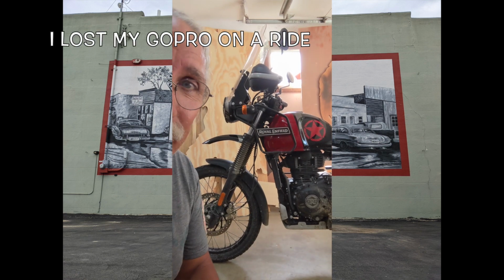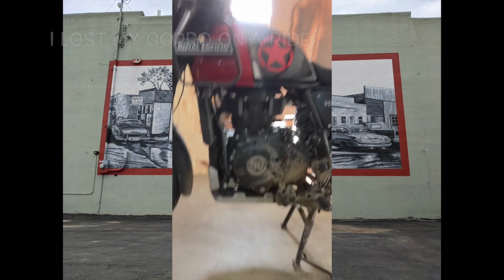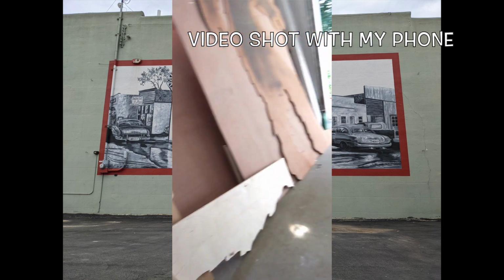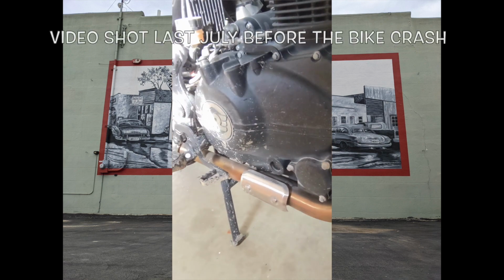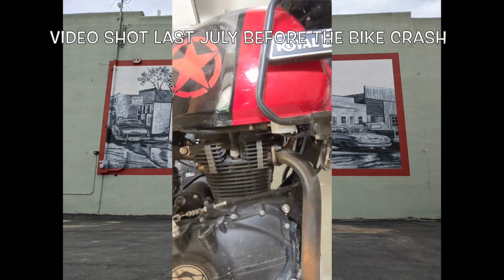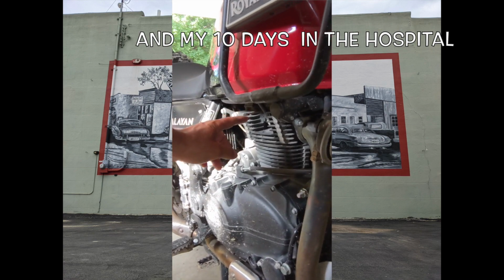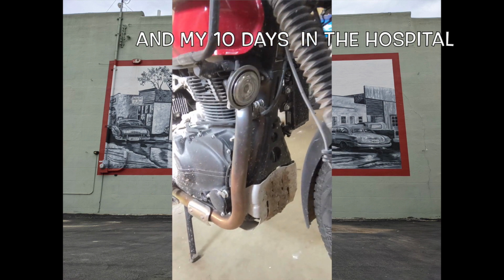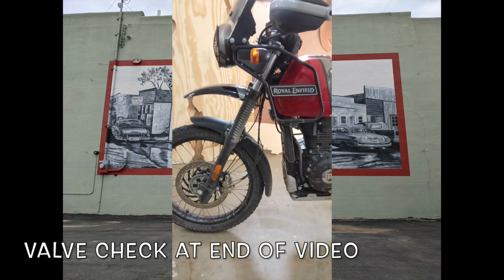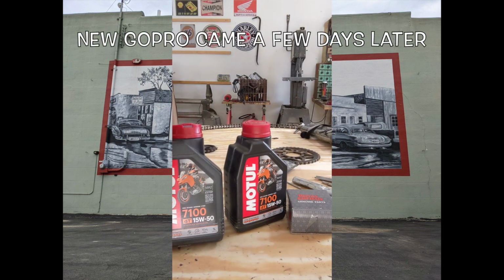That's the Hot Rod Himalayan right there. And tonight we are going to drain the oil out of her. Come over here, we're going to pop the oil filter out. Then we're going to remove the spark plug because it's got about 11,000 miles on it. Put a new spark plug in it. Put the new oil filter in it, and then reload that baby with fresh oil. I call it dragon's blood. This is what we're going to be putting in it.